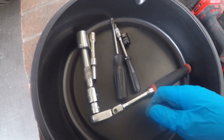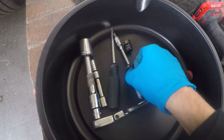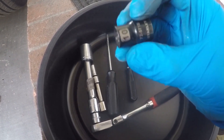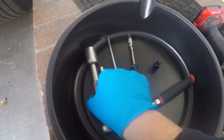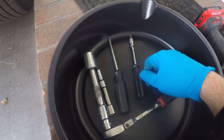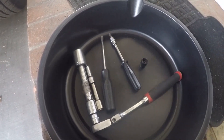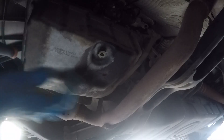The tools you're going to need for this job are: 8 millimeter for the oil pan bolts, T30 for the solenoid pack, 10 millimeter for the plug on top — you may need to switch to a 10 millimeter wrench — and 7/8 to drain the fluid, plus a flathead screwdriver. I may use a quarter-inch impact to help speed the process. That's the drain bolt, so the first thing I'm going to do is drain the fluid. This is 7/8.